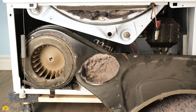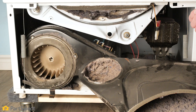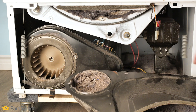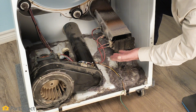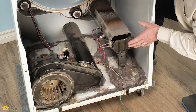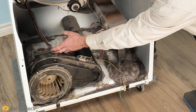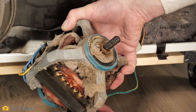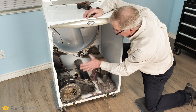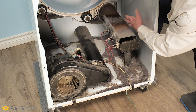This particular one is a pretty good indication that we have a very poor venting system and we'll need to look at that separately. For now, we'll need to remove the drum and the outer door panel here so we can completely clean the interior of this dryer to remove any potential fire hazard. With the drum and front panel removed, we get a really good view of the amount of lint in here and the potential it has to not only reduce the efficiency of this dryer but also how much of a fire hazard it presents. You can actually see on top of the heater where that lint is charred from the heat. We also need to pay careful attention to the drive motor — it will tend to build up with lint as well, causing it to overheat, and it also wicks away any lubrication built into the bushings on that motor, shortening its lifespan. We need to vacuum all of this lint out of the dryer, making sure we get it out of the motor. You may even need to use some compressed air to blow that lint out. Vacuum it all up, particularly around the element as well.